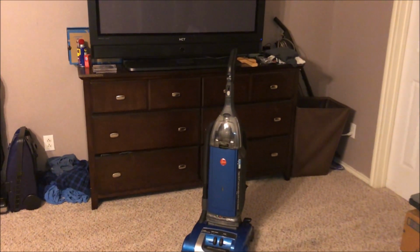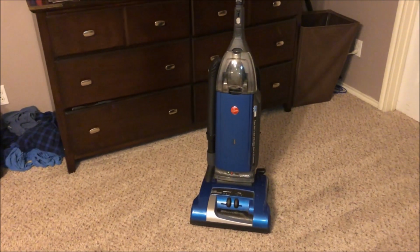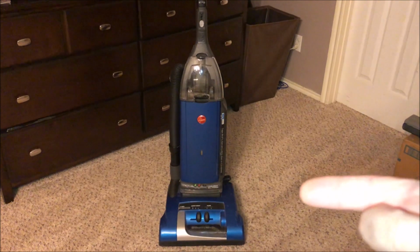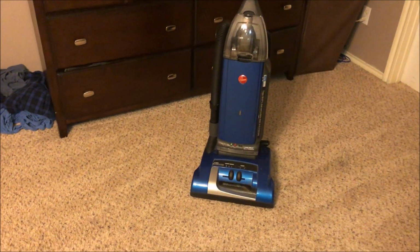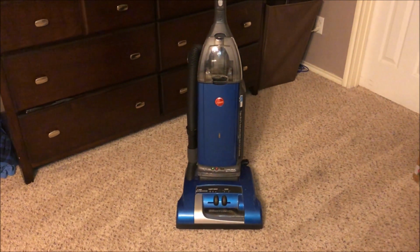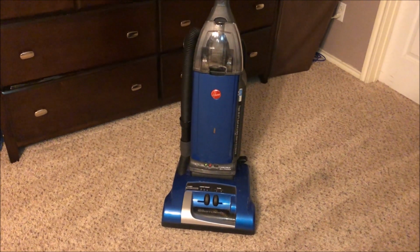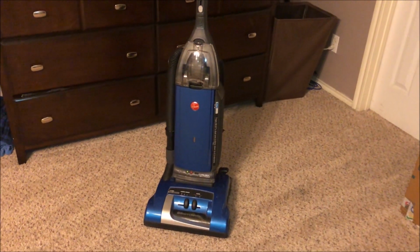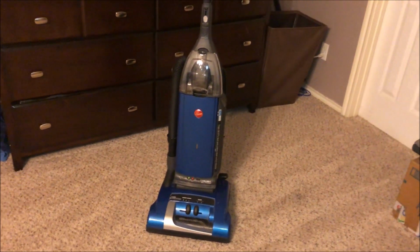Well, everybody, the full house cleaning is all complete. And I just gotta say, even though this vacuum was made in the TTI era of Hoover, when Hoover was still making these old style wind tunnel upright vacuums, this bagged self-propelled, being run the longest alongside the Wide Path Tempo, was essentially the same as its Maytag predecessor. The only difference is the factory CWP brush roll, which honestly is much stiffer than the Maytag version, and also you get a much louder, more high-pitched squealing motor.